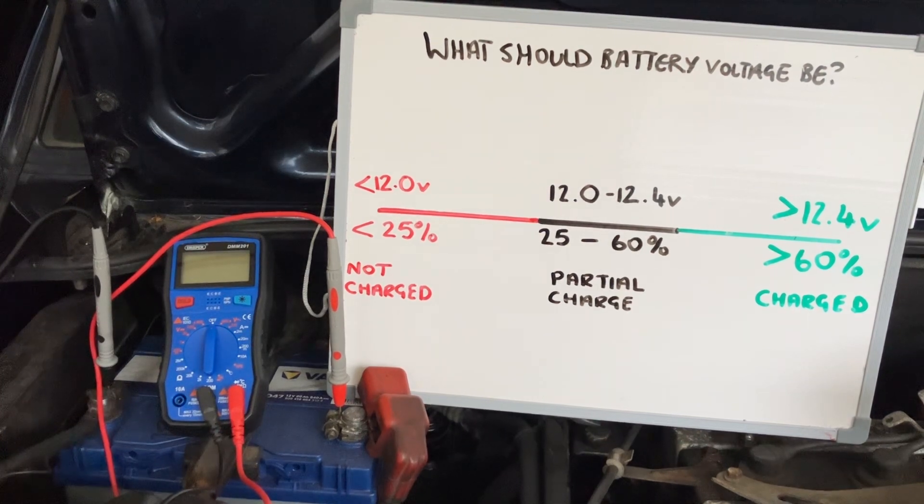If the battery is left to stand for a period of time and gets below 12.4 volts, lead sulfate crystals build up on the positive and negative plates. This stops the chemical reaction from converting to electricity — that process is called sulfation, and it causes a steady reduction in voltage at the battery posts.